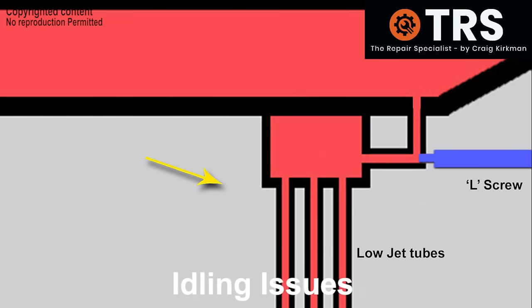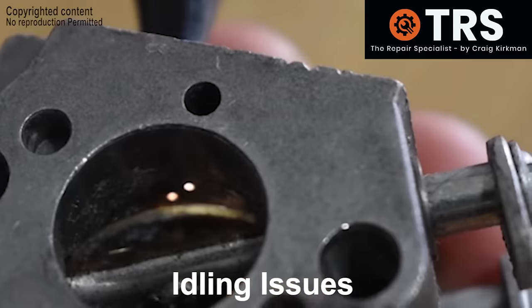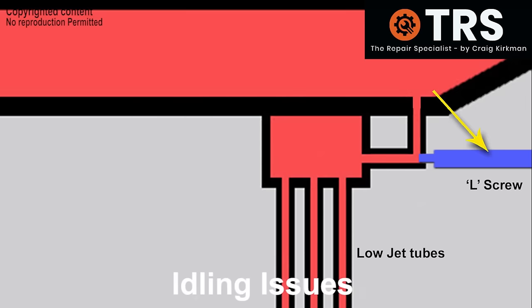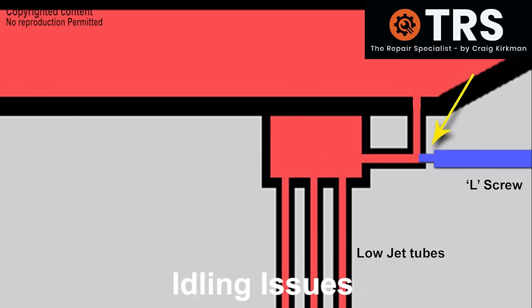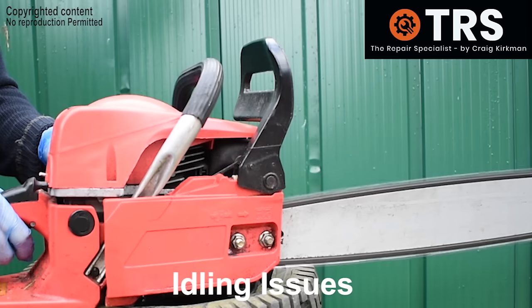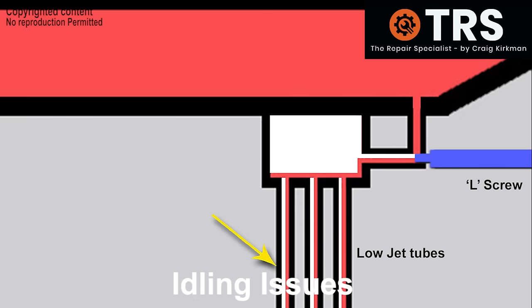Even though some of this fuel comes out here whether it's idling speed or maximum revs, it's the idling speed that's sensitive to the fuel flow from these three holes. If we take a torch and shine through these little holes and look in the induction tube, we can clearly see that all three have a direct route there. Depending on the position of the low jet screw will depend on how much fuel is allowed to flow into this compartment for use down in the induction tube below at idling speed. Its principle is the same as the high jet screw: if we turn this screw in clockwise, its tip will protrude into the fuel way more and restrict more of the fuel entering the small reservoir — and if there's less fuel here, there's less fuel going down into the venturi for the engine's idling speed. When the chainsaw is giving these symptoms, it can be suspected that the L screw is screwed too far in, not allowing enough fuel down the pipes.